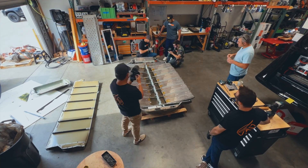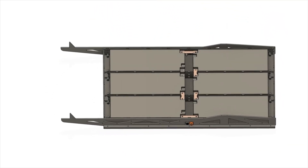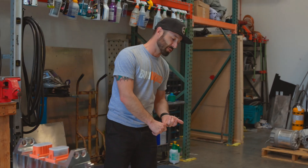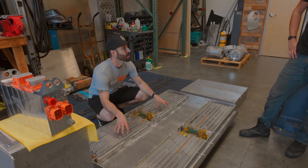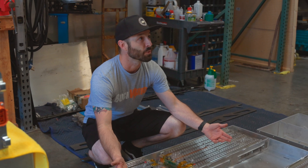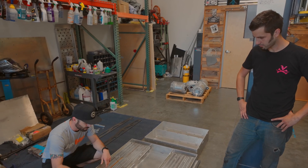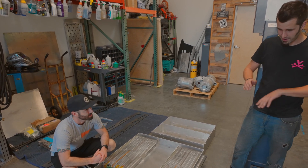We have the 14 modules laid out in a skateboard arrangement, similar to what you find when you tear apart modules from a Model S or X. But much like the Revolt motor, these are turned 90 degrees — instead of the batteries outboarding the coolant to the sides of the car, they're actually front and rear. We're using a combination of 3/16ths, 3/8ths, and quarter-inch aluminum to build a nice structural skateboard. This six-module skate will power something like a 144-volt Hyper 9 setup and would fit in the bed of a small pickup between the wheel wells. We have all kinds of provisions for coolant lines, cell taps, thermistors, and bus connections, with bulkhead connections for everything — you just drop the battery right out and pull the lid off to service it.